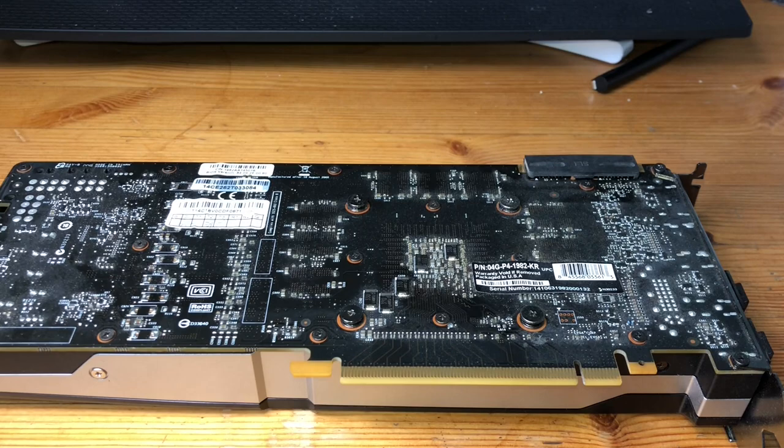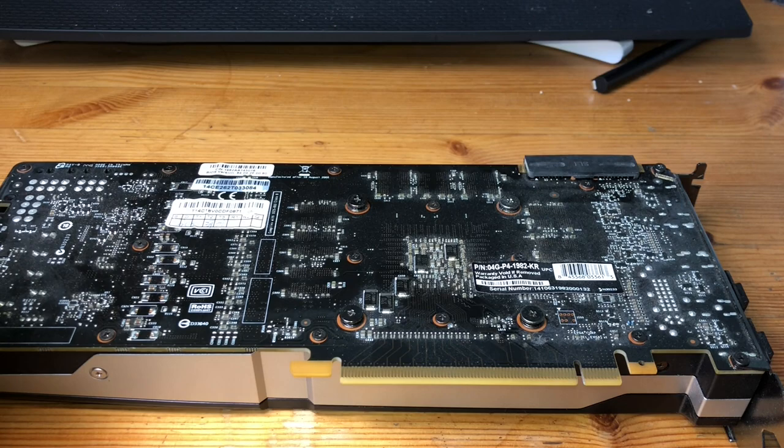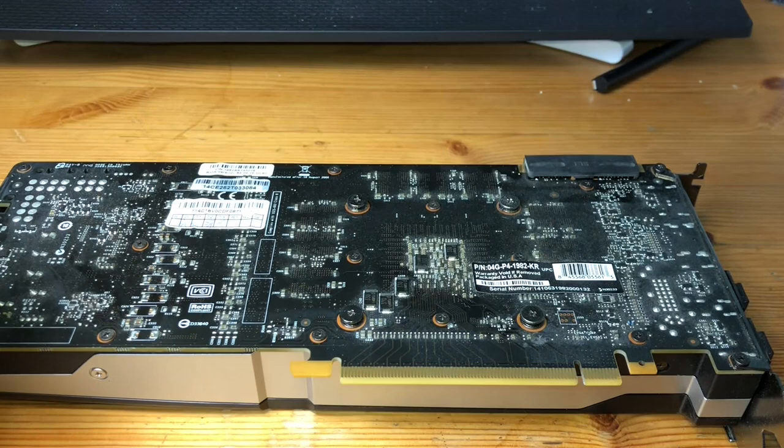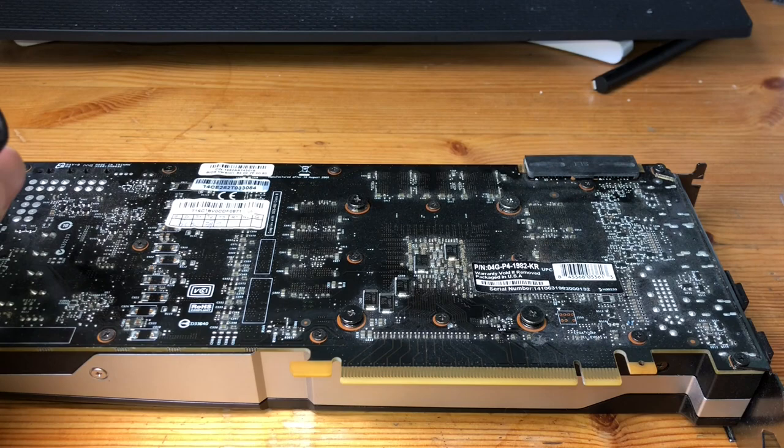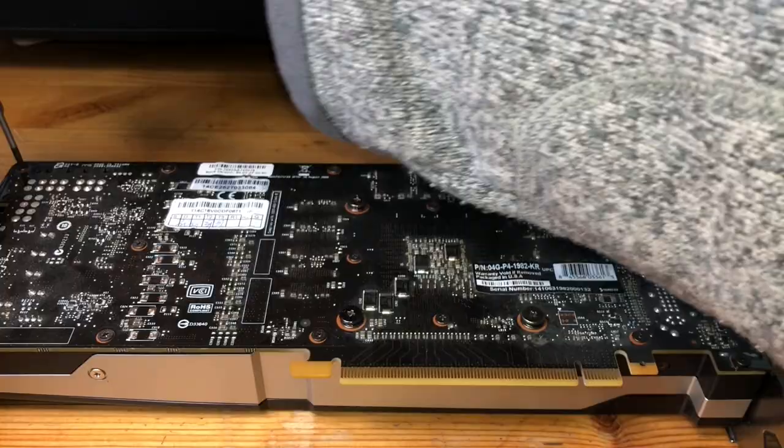We don't necessarily need to hold on to the screws, as ultimately with the new cooler, it's just gonna have four big screws to hold us into those spots. But I'm still gonna hold on to them just in case I need to put back the cooler at any point. I do have this nice anti-static part separator to help with capturing all the screws. It's very helpful. If you don't have one of those, even a simple magnetic tray can help keep everything in line. So with that, we'll go ahead and start taking our screws off.